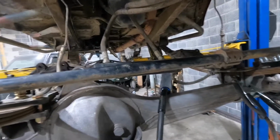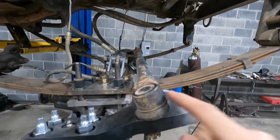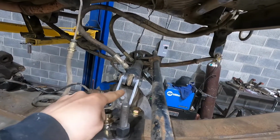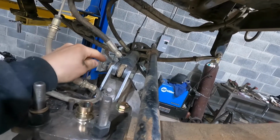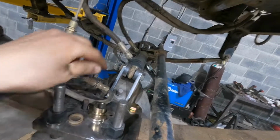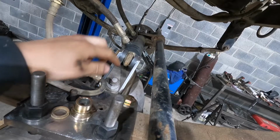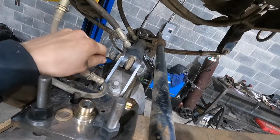I was thinking the steering bar is going to be mounted in the same location. It's just going to have heim joints instead of tie rod ends. So I figured I could do the axle mount, which I got done. I actually had to do it twice because I didn't like the way it was done the first time. Then I got it all figured out, and the kit comes with these little spacers, and I put them in, and it was too narrow because it hit the breather. So I just made new spacers to make it wider so I could go down across the breather instead.